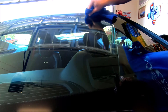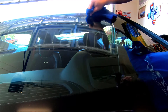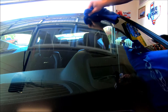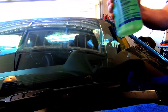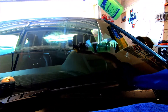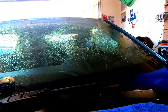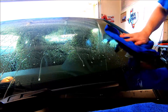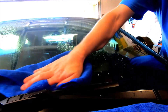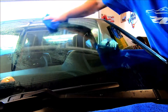WD-40 has a lot of uses — it's great for removing adhesives, rust, and all kinds of things. Don't be afraid to use it; it's even okay on paint. We'll use diluted Simple Green to get the WD-40 off the windshield. You don't really want Simple Green on the paint because it is a degreaser and it will strip wax — it won't hurt a ceramic coat, but it will get normal wax right off, which is fine if that's what you want to do.